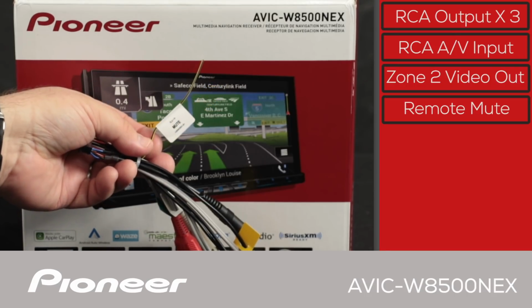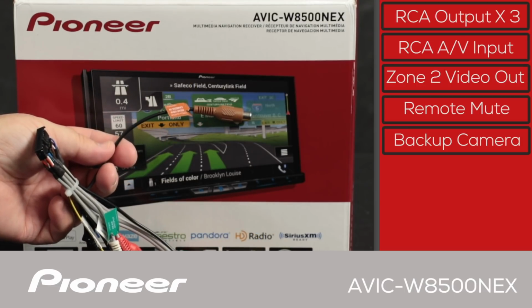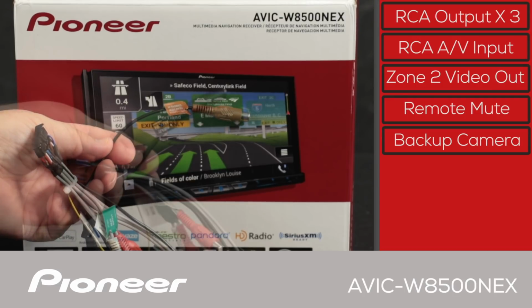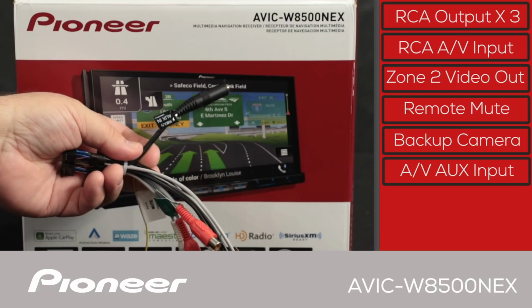Here's the system mute. It can be used to mute the audio system if required by an external system. The brown jack here is the dedicated backup camera input. And finally, the black jack here is the audio and video auxiliary input.